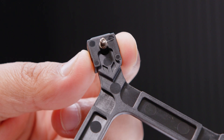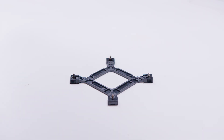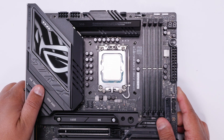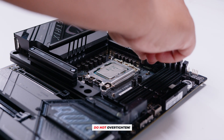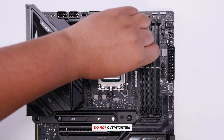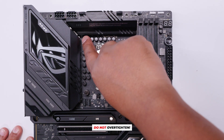Next, locate the Intel backplate. You'll need to adjust it based on your motherboard: the inside offset is for LGA 1200 and the outside offset is for LGA 1700 — they're very easy to move. Place the backplate on a flat surface and lower the motherboard down onto it; if the motherboard is already in your case, just hold it by hand. Finger-tighten four of the bolts onto the backplate standoffs and repeat until all four standoffs are in place. There will always be a little movement once Intel coolers are mounted with their backplates — that's normal.